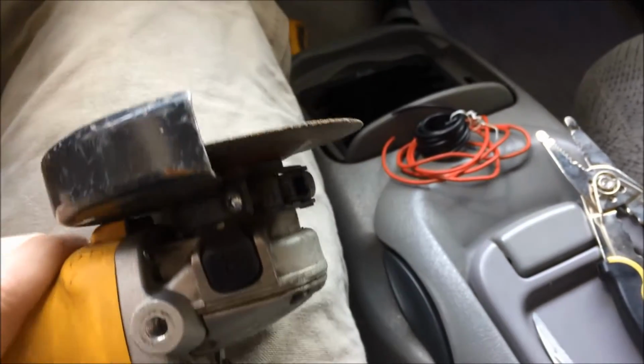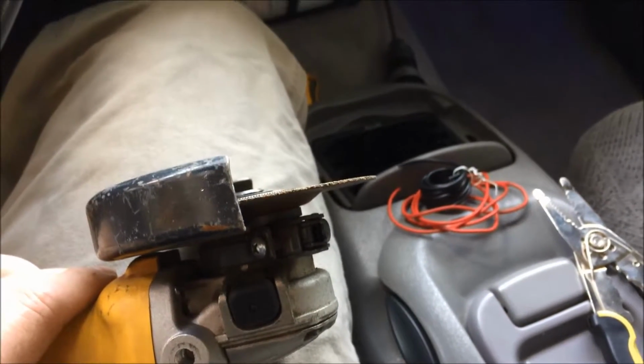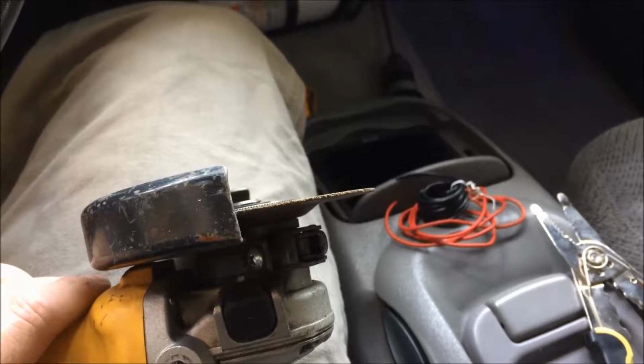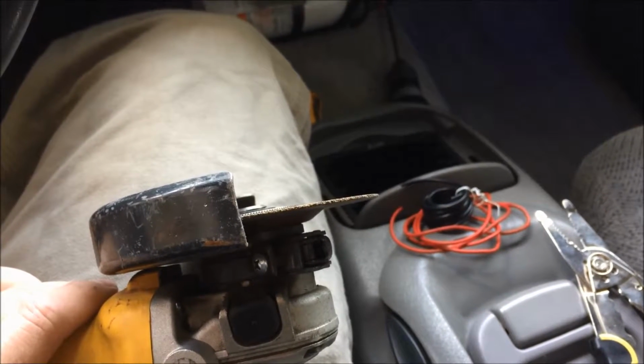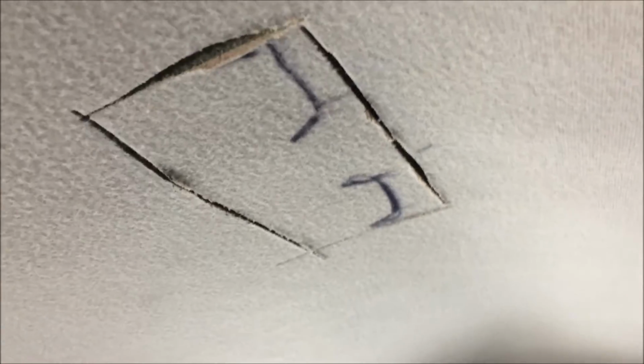And I found cutting through this headliner, that's your monster right there. A thin blade cutoff wheel does beautifully. Just got to be careful not to melt your headliner stuff too much, and definitely don't want to start a fire either, but you're only going through just a little bit, so this should be quick and easy. I hope. Oh, now my ears are ringing.